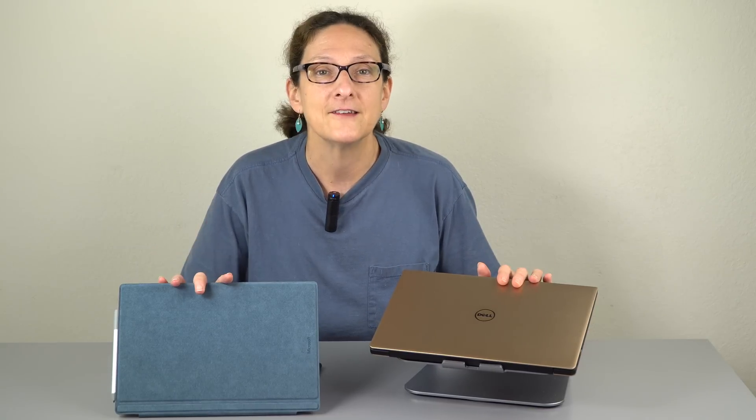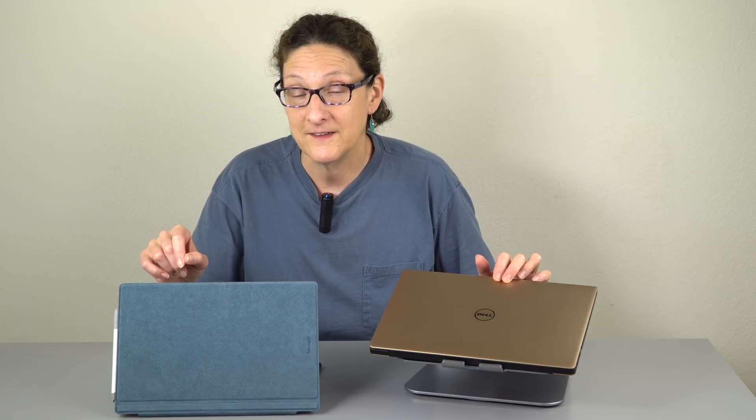So what's the deal? If you go up to Intel Iris 640 graphics, you're still getting a 15-watt dual-core Ultrabook CPU. And typically those end in 60, so it's like Intel 7660. When you see those Intel CPU numbers, like the regular base XPS with the Core i5, it's i5-7200U — it ends with 00, so that's how you know the difference. If you're talking about Iris Plus 650, the highest end, that typically ends with a 67 in the CPU model number. They're linked together, CPU and GPU.